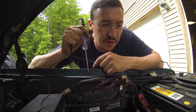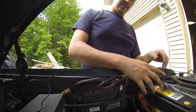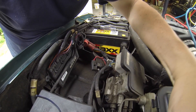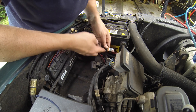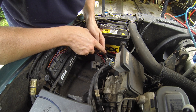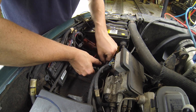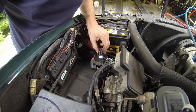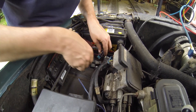Don't be afraid of electrical troubleshooting, but you have to start with an understanding of what's going on. Also — and actually this should be the first thing you check when troubleshooting electrical — check your fuses. This harness has a fuse in it. That squiggly line inside should be continuous and not broken. I check it and it looks okay — that silvery element is all silver, so the fuse isn't blown.